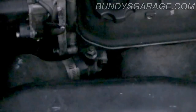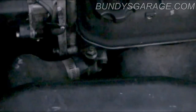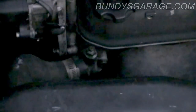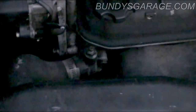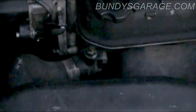A couple things to note: be careful when you put the fans back in — do not score the inside of the radiator or damage the fins. There are no bolts on the bottom part of the fans; they just slide into place. All the bolts are on the top. And it's a good time to change the upper and lower radiator hoses and the thermostat as well. If you find this video helpful, please subscribe or like and leave a comment, and I'll keep them rolling for you. Thank you.